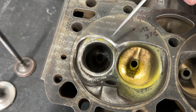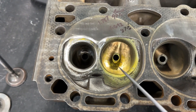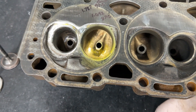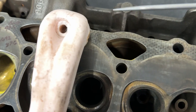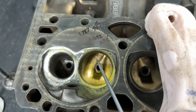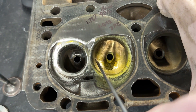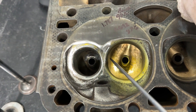Now the other thing about grinding these is that the port starts square, which takes a bit more talent than grinding an aftermarket head. Look at this ridge — it goes almost square into the port, not rounded like an aftermarket head would be. An aftermarket head is more curved and you just follow the contours to make it bigger. To properly size this bowl for the port you actually have to focus your grinding here first — working this region until you get a round shape, then start rounding the full area. Otherwise you end up with what he has here — a shape that's still partially square because he started going back and forth before establishing the round first.